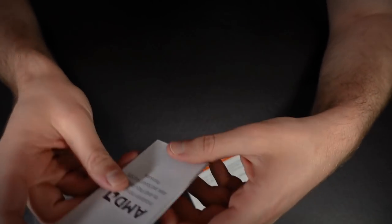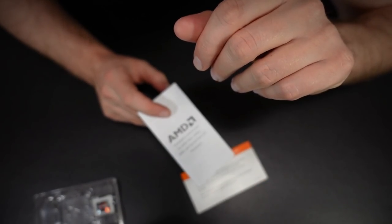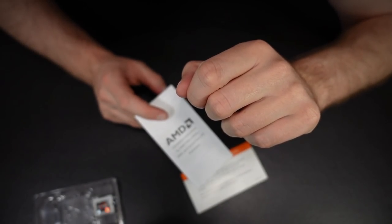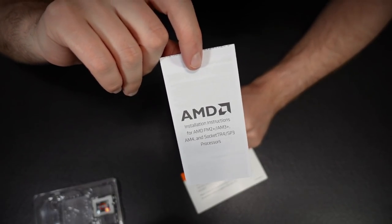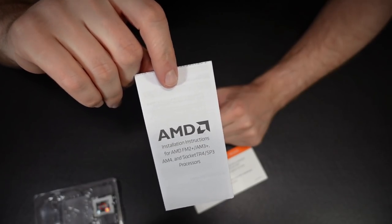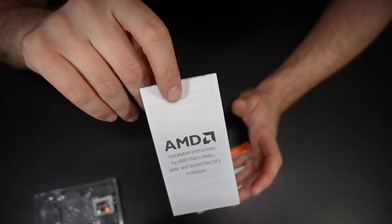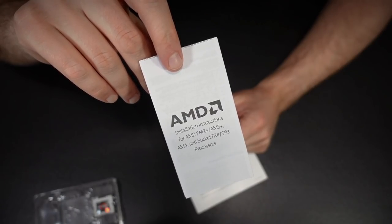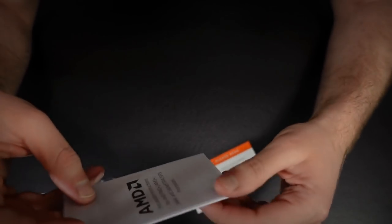Here is a warning note — the AMD Ryzen 5000 series desktop processor is compatible with AMD socket AM4 motherboards when a compatible BIOS update has been installed. The motherboard I've got does have that flashback feature which allows you to update the BIOS without a CPU in there, but the other way is to use a previous-gen Ryzen 3000 CPU, update the BIOS, then swap to the new CPU. The shop had those kicking around — I do not. So that's yet another good reason to let them install the CPU.